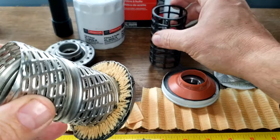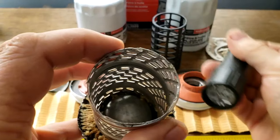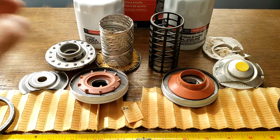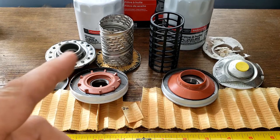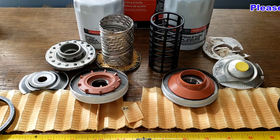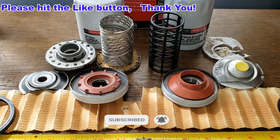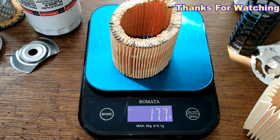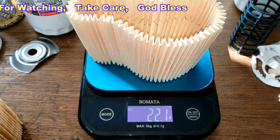The cores on the old filter have louvers that open up nicely — no problems there. Overall, I'd go with the old Motorcraft because I like the base and bypass valves. The only problem with the old one was the excess glue. Otherwise, you wouldn't go wrong with either. The old Motorcraft filter media weighs 17.7 grams and the new Motorcraft filter media weighs 22.1 grams. Thanks for watching — don't forget Oil Filter Fridays, where I open up a filter every Friday on this YouTube channel.